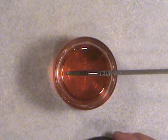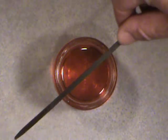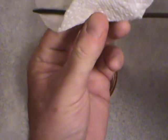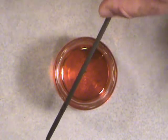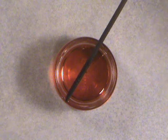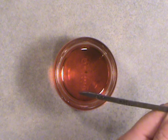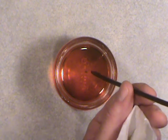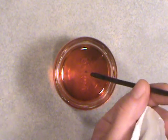Okay, so where do you do that? So we just withdrew the dipstick from the engine, okay? We're not sure if that's the real reading, so what we'll do is we'll clean off the oil that's in there, and then we'll reinsert it into the engine and count our 3 seconds, right? And then we can take that reading. Now I'll go in again. That first part was when it was under ideal conditions. Okay, now we'll reinsert that stick, and I'll give you another scenario here.